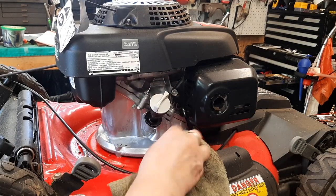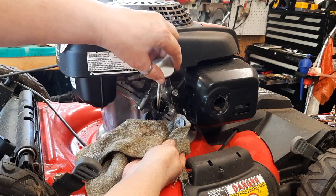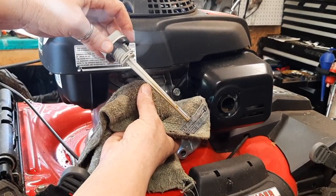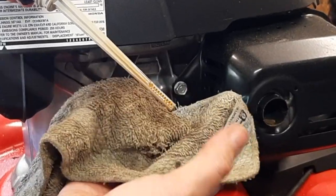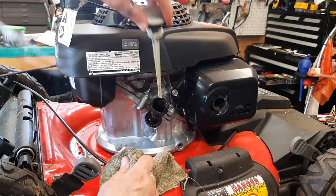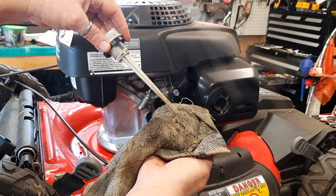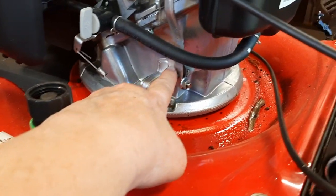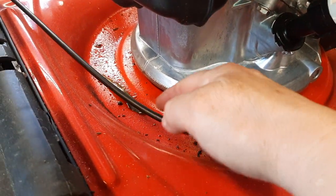The amount of oil in here is crazy. I showed this to the lady — you can see it is all the way up on the dipstick; it should be down here. More than double the amount that should be in there. There's so much oil it's above the level of the governor, so that's where it's pouring out and all back over the deck again.